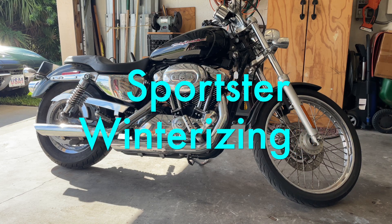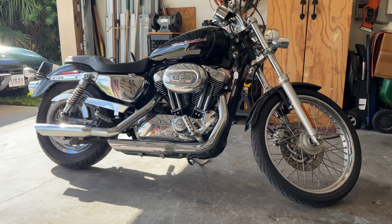Good morning. Today we're going to go through a video on my 2005 Harley-Davidson Sportster XL1200. We've been working on it. I want to do a video on winterizing the motorcycle and the things you must check. We'll go through the oil, the brakes, tire pressure, battery, and keep it on a tender through the winter. Start by letting it run down so the carburetor is not filled with fuel, and check the primary chain. With that, let's get started.